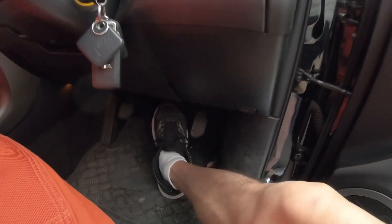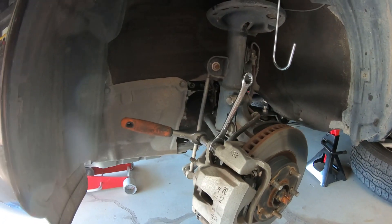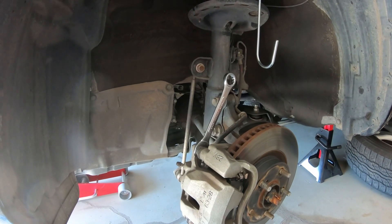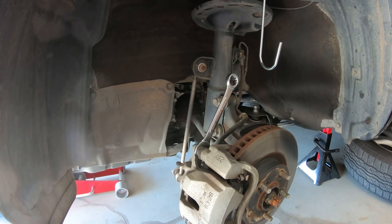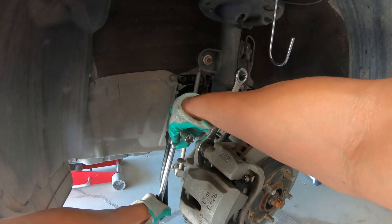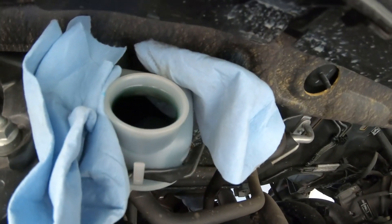Let's try the brake a few times. Push it. It did go down, but not by a whole lot. Sometimes you need both wrenches and a socket when putting it on like this — same when you're using the torque wrench. I've had to use the turkey baster to remove some of the excess brake fluid. You can see it's just coming right up to the top.